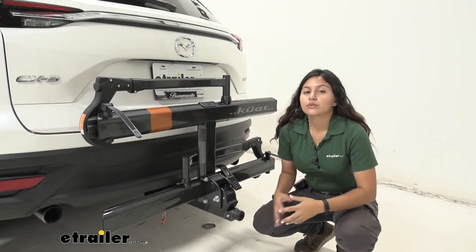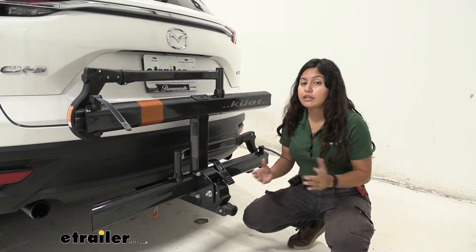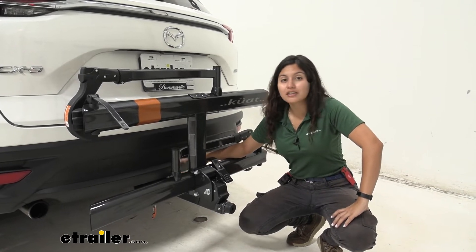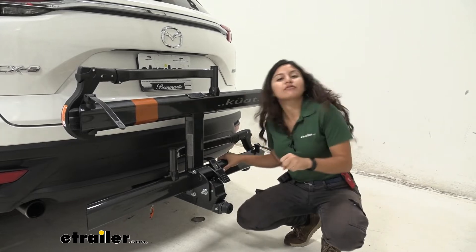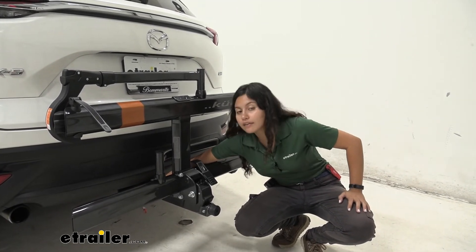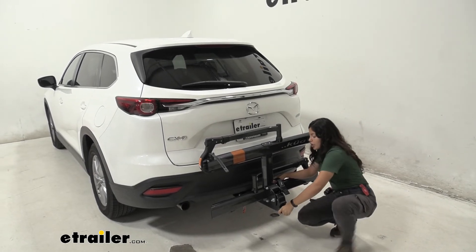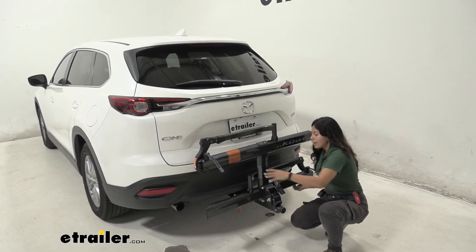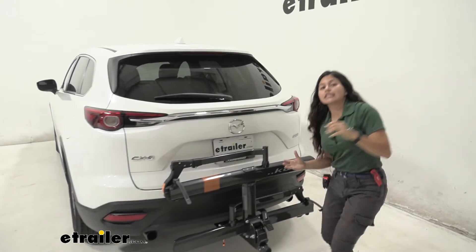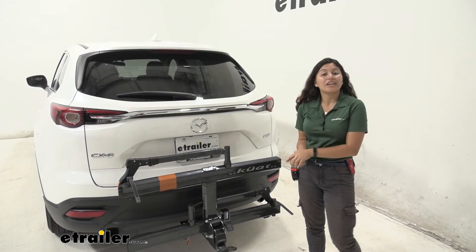Now let's talk about how this fits into our hitch. This has a two inch shank — the Sherpa also comes in an inch and a quarter shank, so just make sure to get the one that matches your hitch receiver. I have the hitch pin alignment collar from etrailer so that as you pop it into your hitch you don't have to look back and forth to make sure it's lined up — you just pop it in and then add the hitch pin lock. That lock keys to the cable lock that comes with this bike rack. It's a tool-free install: you just pop it into your hitch and tighten it down by rotating this knob, and as you can see with that tightened down completely, when I shake the bike rack I shake the vehicle, showing how tight and secure the connection is between both our bike rack and our car.